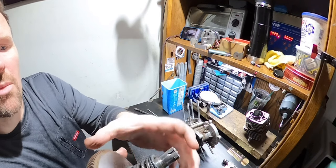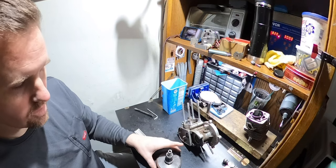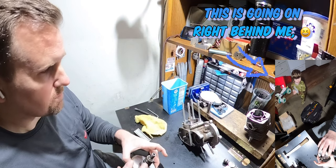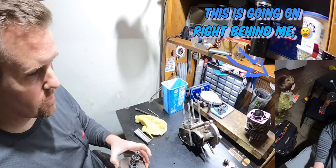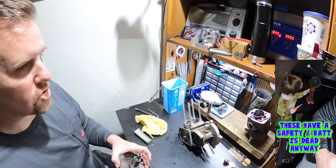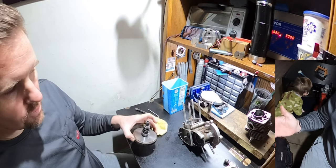Major scuff marks coming out of the bearing race on this side, on the bucking arm side. I tried to be gentle, obviously, because I want to reuse it, so it started to mushroom a little bit. I'm starting to get frustrated. I'm trying to find some way to keep it from doing that. Try to put the nut on. The nut is just going to beat right down and strip the nut out, so I couldn't do that. The end result is there was no saving it.